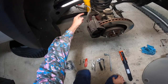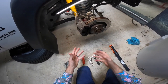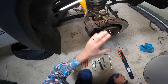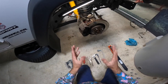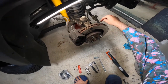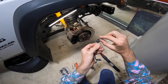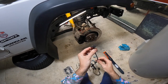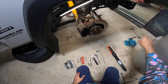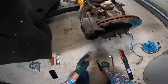Just be very careful — my rack assembly broke on the other side. If your car has been driven up the beach a lot and this is your first time working on it, just be very mindful of corrosion — that little connection there broke on mine. This should only take about an hour to an hour and a half depending on what issues you run into. I actually broke the wheel speed sensor tip off inside the hub, so I'll leave a link on how to remove that broken part if that happens to you.